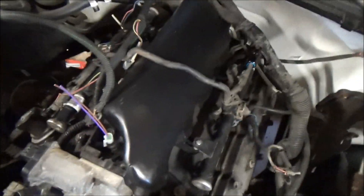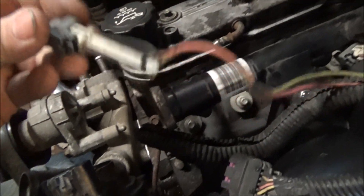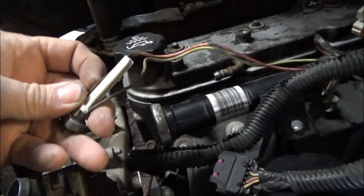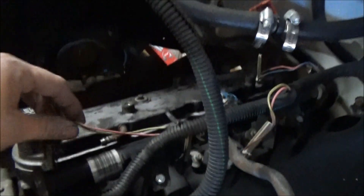We're up here underneath the engine. I've gone ahead and set the intake on and laid out the harness beside it. What we're going to do is cut off these old Delphi clips and get ready to start soldering on our new style. Injectors are a coil so there's really no polarity in this particular model — no diodes or anything — but just to keep it consistent, we're going to do the same color to the same color the whole way across: pink to the red and black to the yellow. These pigtails have a long tail on themselves so there's plenty of extra.